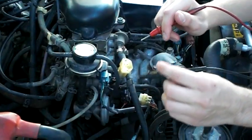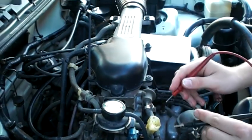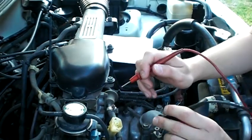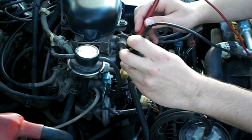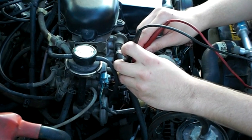I've already disconnected it from the clip. I've already put the tie strap here to hold the throttle completely shut, with the dashpot pushed in. I have a written-out diagram here — looking at A and D, which should show 3.5 to 6.5 resistance. Mine shows 5.09.